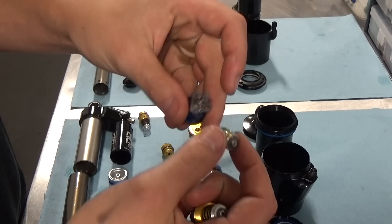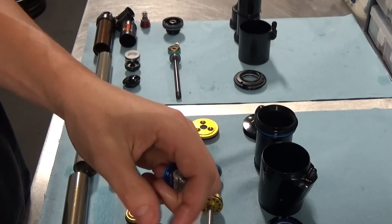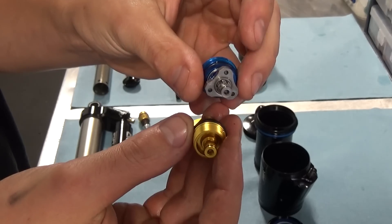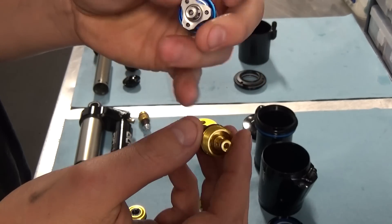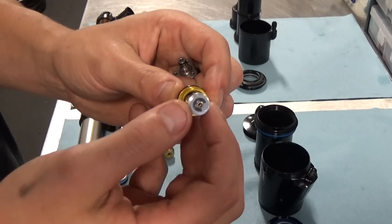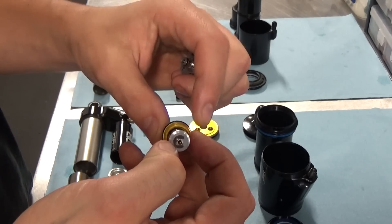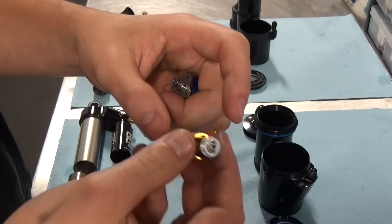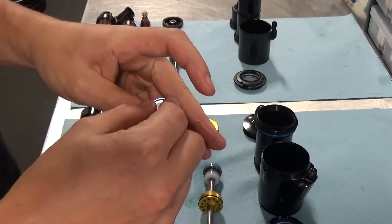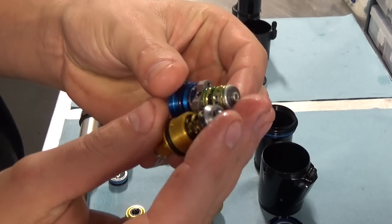The low speed flow in both cases comes through these little holes in the middle — there are low speed metering needles that restrict the oil flow through there. Once the pressure builds up enough to open the poppet valve, the available flow area is much higher through that. The similarity in the poppets is really very large; they are pretty much identical.